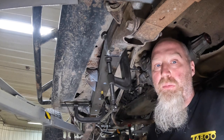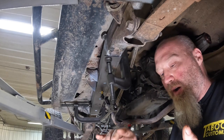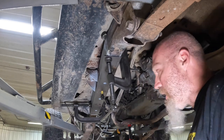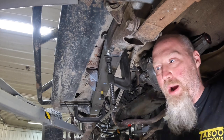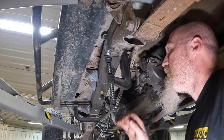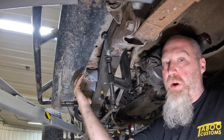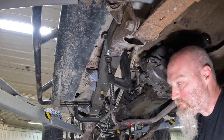However, you may also want to make sure your frame doesn't have any slag or spatter or wires left over from the welding of something on the frame. Actually, on the passenger side, we had one of those that was holding it off, a wire thickness essentially, that we had to pull off of the frame. So we'll close up all of those gaps now, and we will now work on our outer plate once we get these bottom pieces solid welded.